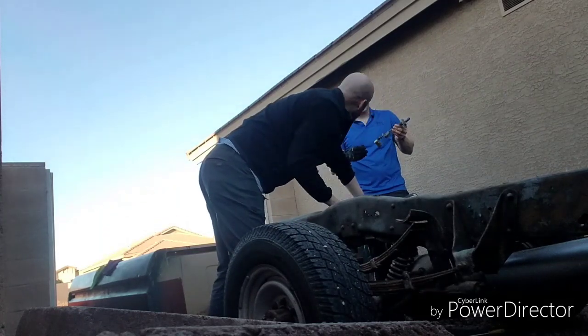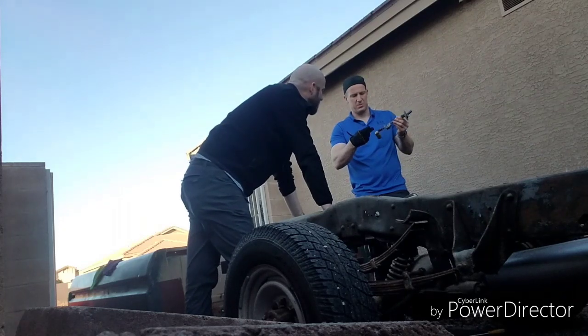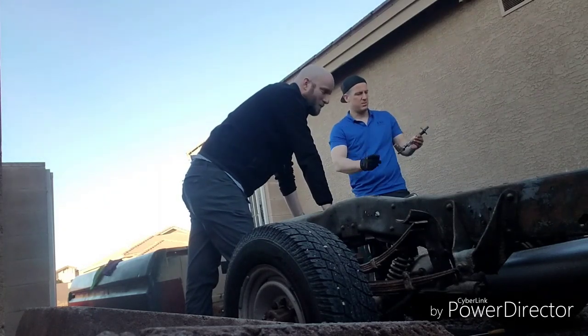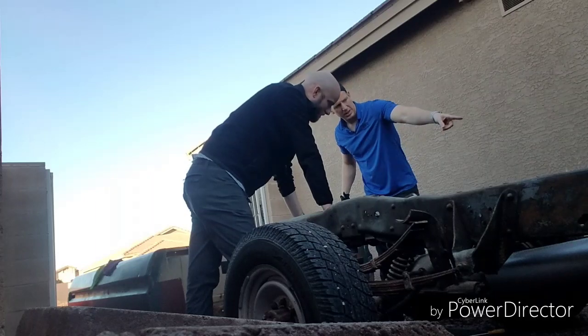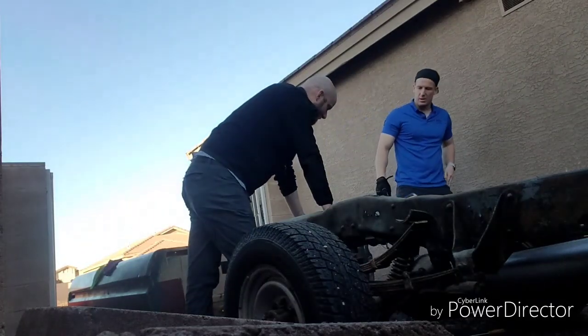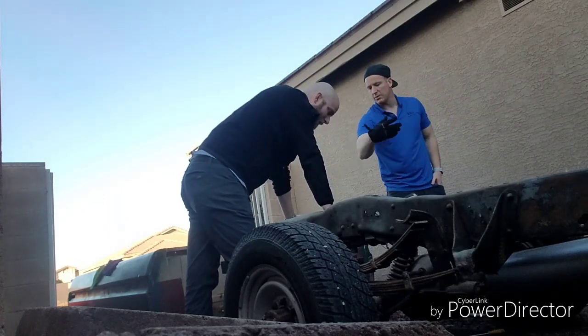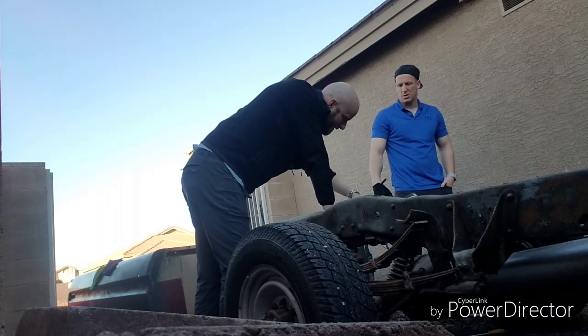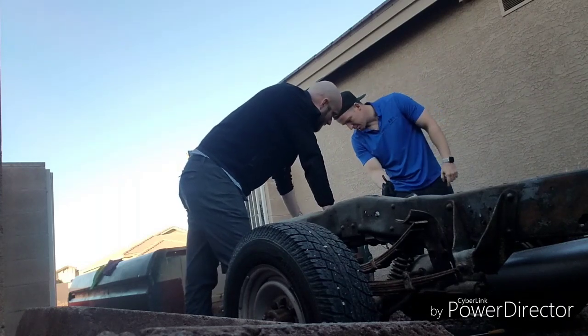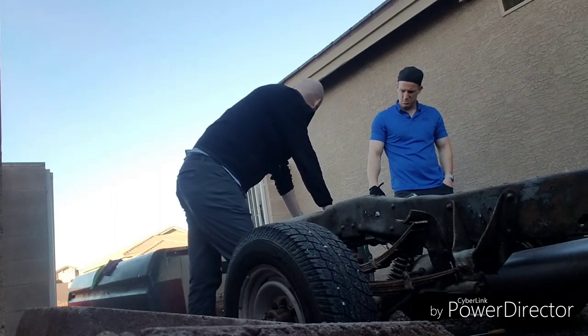Yeah. I bet you that clogged up somewhere in the fuel line. This preliminary filter. And then just stuck in there somewhere. But no problem. We'll just take it out there and just run that black line all the way back into here. Yeah. But we will have to take this off and clean it because we want this line to seal it here so it's not letting fumes out. Shouldn't there be a seal right here too? Right here. Oh, okay.